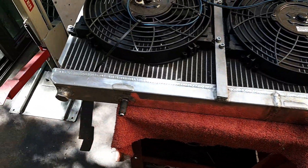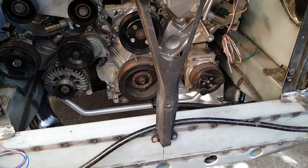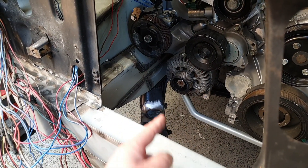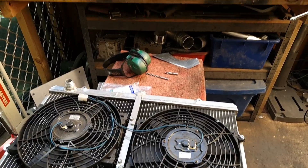With slightly different mounts on the radiator it's basically going to bolt straight in. I need to chop the mounts off - they need to be slightly further in and slightly further forward. Those holes there are the original factory Silvia mounts. Because I shortened the mounts up and they're on an angle in the car, each of those holes has shifted across as I moved them, so that's why the mounts don't bolt straight up as they might have originally.